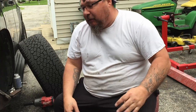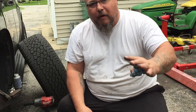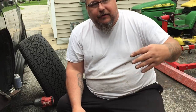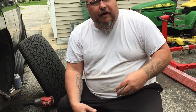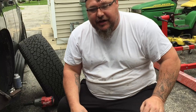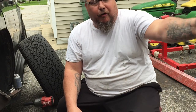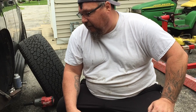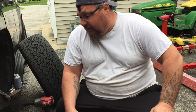I just wanted to do this video — I could have just fixed it and said nothing, but I want everybody to learn from my mistakes: you cannot rush wiring when you're doing this stuff. Obviously it didn't hurt anything electrically, no chance of anything burning, but it definitely hurt the performance of the motor. I'm at 36 degrees total timing, and I was pulling six degrees every time I was on the floor — running it out the back door with only 30 degrees of timing.